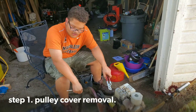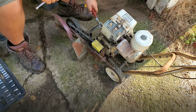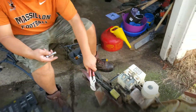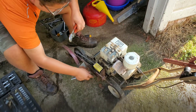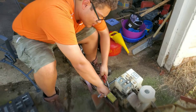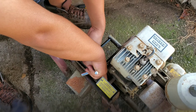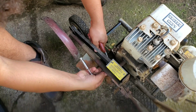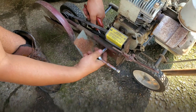We're going to start pulling this motor. Taking this motor off, we've got to deal with three things: this cover, the engine mount bolts, and the choke cable. I think I'm going to start with the side cover. It's three-eighths bolts on the outside — these two bolts down here I think they're three-eighths inside. You come over here, got to get the belt out of the way, slip these in, and grab the bolt inside. Two bolts should get this off — at least that's what I've found. It just depends on how your edger is set up.